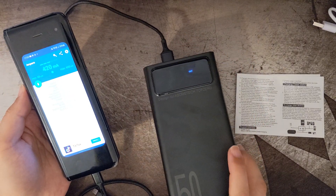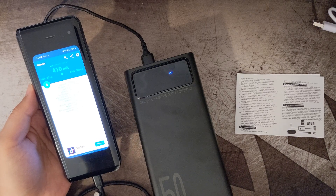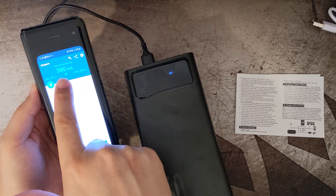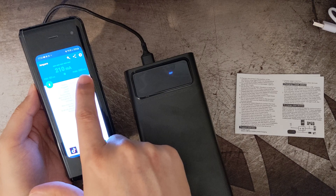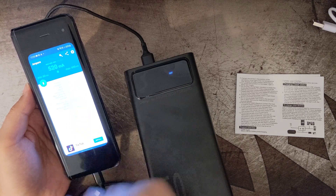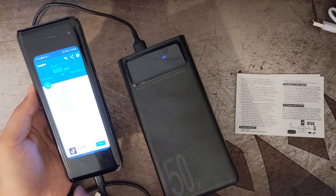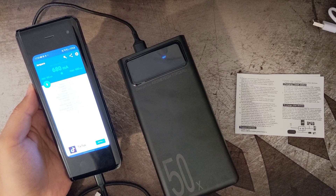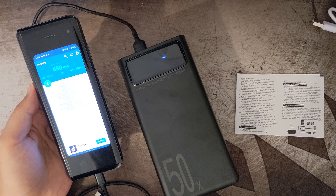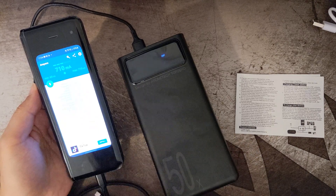I may do a follow-up review testing with a USB-C to USB-C cable and report the amperage in the description. The charge is fluctuating but climbing — the maximum hit 600mA, averaging around 400mA, with voltage rising to 3.82V. This might improve once the bank is fully charged, as I just took it straight out of the box.